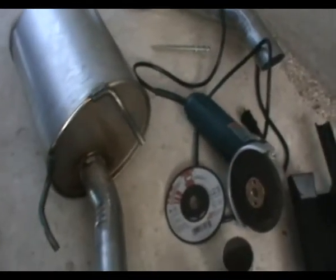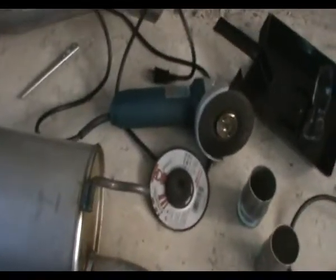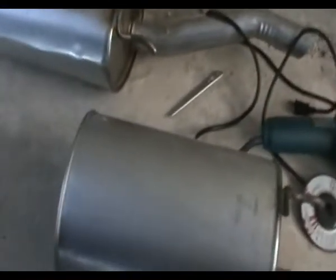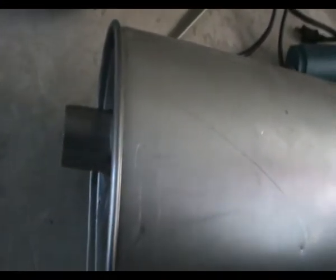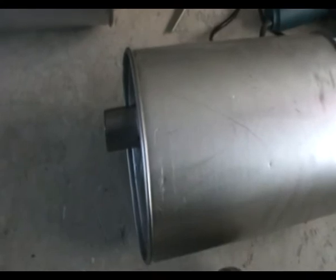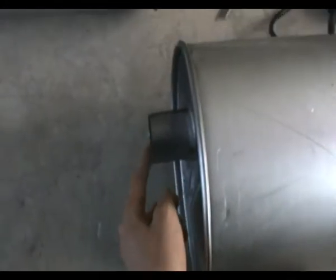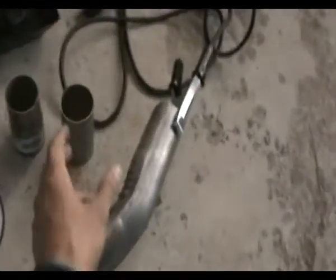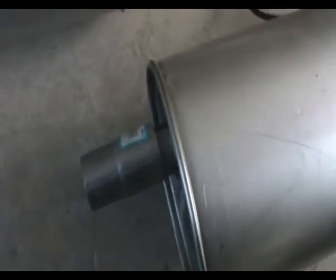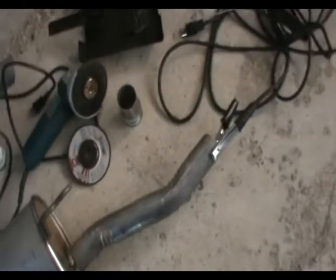The worst thing that can happen from experience of changing mufflers: the cutting with a grinder — that's very simple, anybody can do it. The welding, you could screw up. If you do, don't panic — with pliers you can knock it out and break the weld. What I suggest is get a pipe exactly like this one and get the attachment, and practice by welding the attachment to a pipe you bought extra. Until you get it right, then do it on the real thing. That's how I started — I brought a pipe and practiced on it.